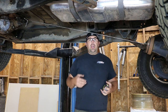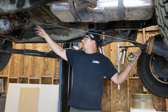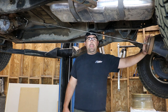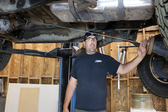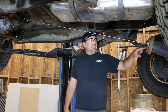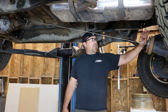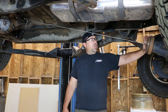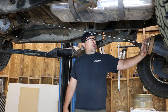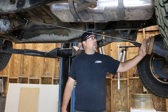One of the things that I do to help me, and also to help you visualize at home, is I put a piece of string from the yoke here to the flange. Now this right here is what they call a companion flange, and if you're going to have a driveline made for it and you don't have the adapter that goes to a U-joint, you're going to need to know the diameter of this index, whether it is male or female, and also the bolt circle — these bolts going around here. We need to know the distance between two bolts if it's a square pattern, or the distance on the imaginary circle depending on the amount of bolts. There are a few drivelines out there that just use three, that's why I say that.